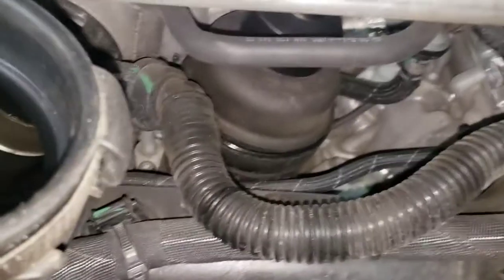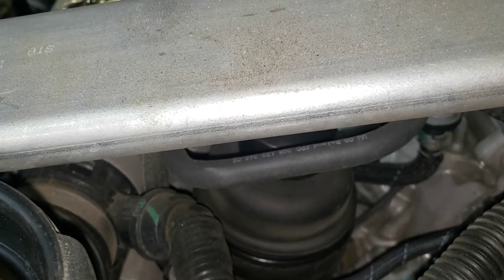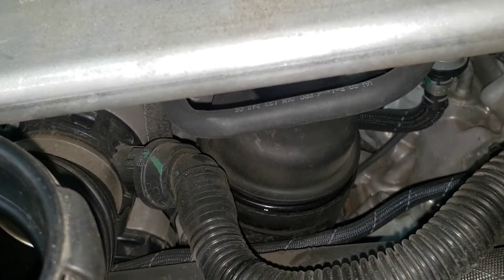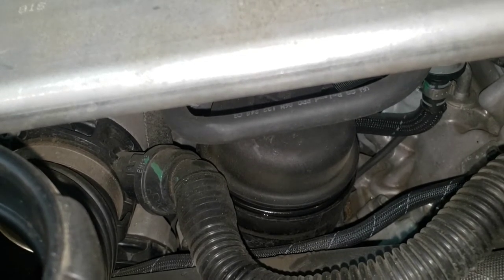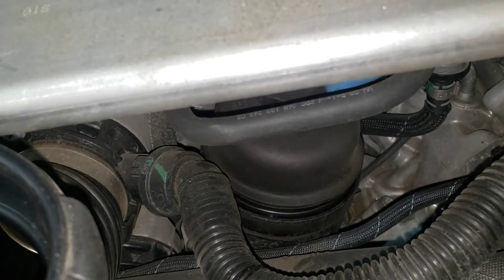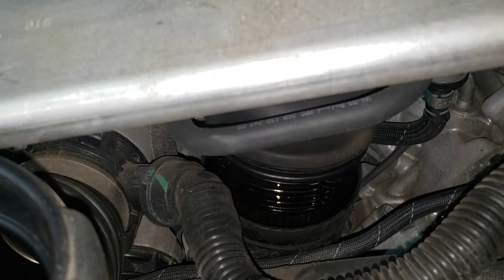If you were to do this first, look down and watch that gasket — if you haven't already drained the oil, some would leak from there. I would normally stop there; you can see it bubbling a little bit, give it some time to work down. Then you should be able to take it out without making a mess. You can spray some brake cleaner to clean up any oil. There shouldn't be much left since I already drained.